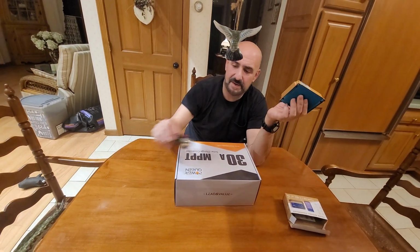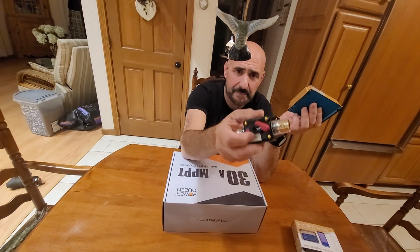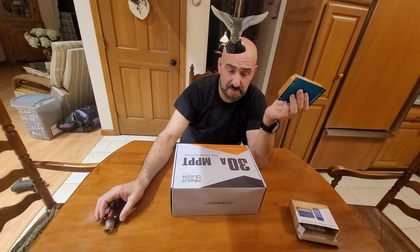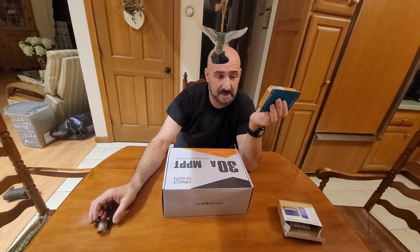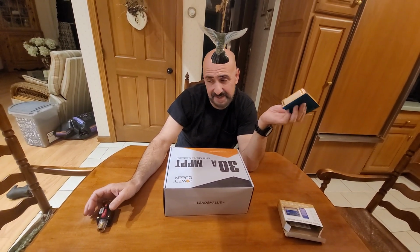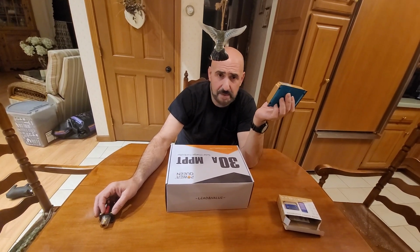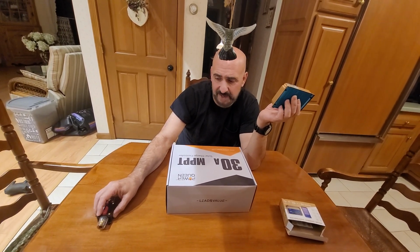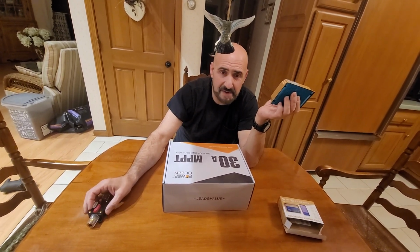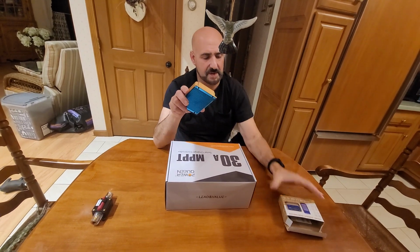I do have a 500 amp breaker that's going to be tied in. I'm using 0 cable, so it's real thick. It's almost a half inch. And I just felt safer with the flooded lead acid. Yes, I can go AGM as well, but that could be a later date. I used 2 Group 31s, so I've got plenty of power to keep this going for 2, 3, 4 hours without any trouble. So I'm not too concerned about that.